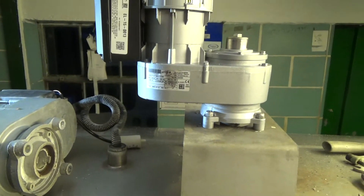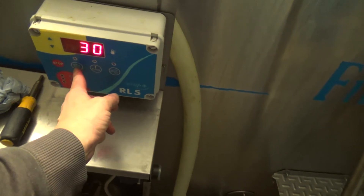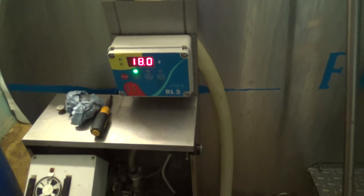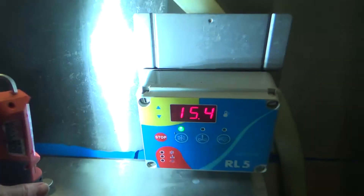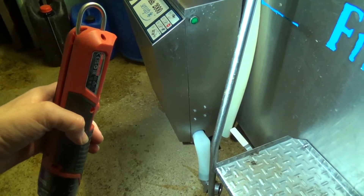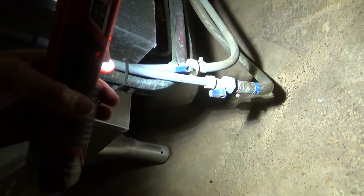And then we've just got to wire it. That's it going. It's got cooling - it took quite a few degrees when we turned it on, a couple of degrees at least. We checked the wash as much as we can with milk in there, all the solenoids work. I can't check the level sensor. And there was a weak capacitor on the wash pump, so that might have been the issue we've had. We just make sure both taps are open. So that's about it, really.